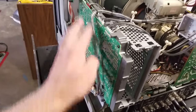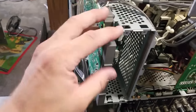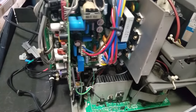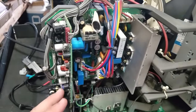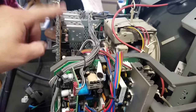This board at the back controls your input card. You most likely won't need to worry about capacitors on that board going bad — it's not a high-use unit board. The most important things are: a few capacitors on the neck board worth changing, the deflection board area, and if you have power issues, check the components near the flyback and this power board — those capacitors could be changed too. If you want to do every capacitor, cover the power board, deflection board one and two, and the neck board.